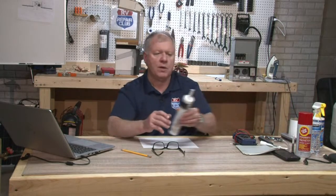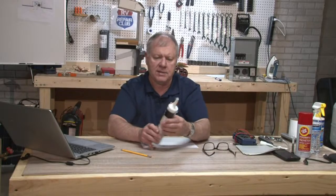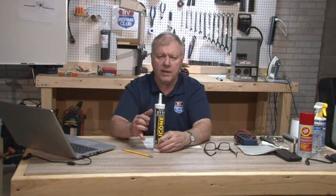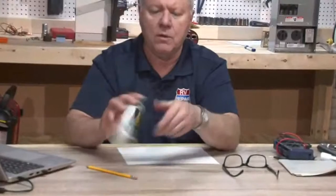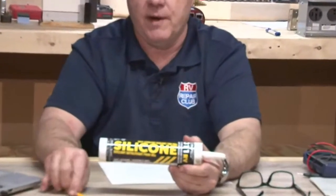That's a good question, Jim. We've covered a lot of this in some of the classes and videos online, but I'm glad you brought this up because you don't want to use just any run-of-the-mill silicone or sealant that you can get at a home improvement store. It needs to be specific to the material that is on your coach. Now, this happens to be one we got for fiberglass, and it's called 311 RV, and it's designed exclusively for the fiberglass cap and the fiberglass skin of a Winnebago RV because they use fiberglass on theirs.